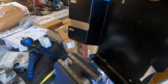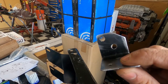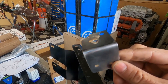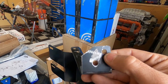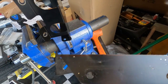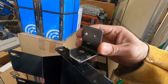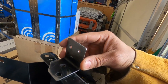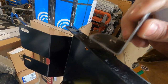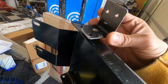The reason we bent it that way: when we mount it, this flat side will sit on the firewall. I also made these little L-brackets — I took an old piece of Vintage Air metal they used to mount the AC condenser with, cut it straight down the middle, and made two of them. That's why there are two holes in there — it's a pre-existing hole from the original bracket. We bent them so they can bolt to the top and to the bottom underneath the support. And you want this removable, guys — if you ever need to do any work in there.